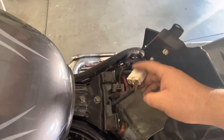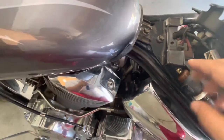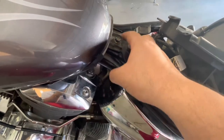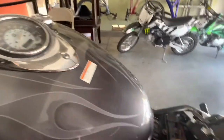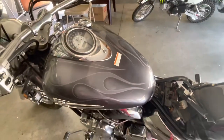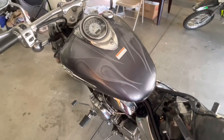This is a wiring harness that feeds the speedometer and all the lights — someone's gonna have to unplug it. Once we unplug this and undo the 12 millimeter nuts, we should be able to lift it up and wiggle it to pull it out. It's only the plastic grommets right here holding it. So really there's nothing else we have to do other than removing the hoses, one harness, and these two bolts. Then we'll pull the gas tank out.